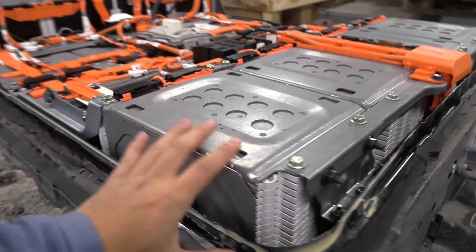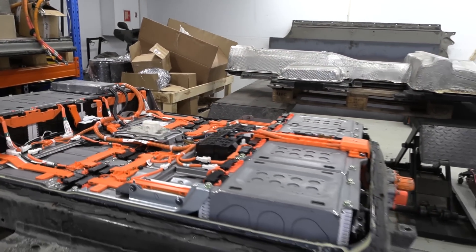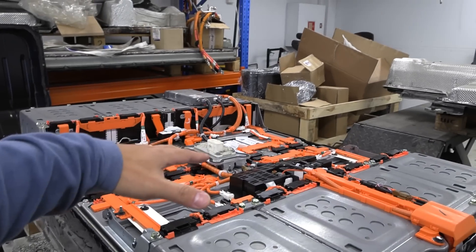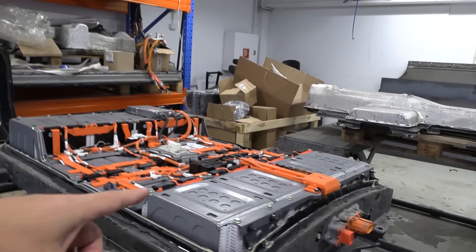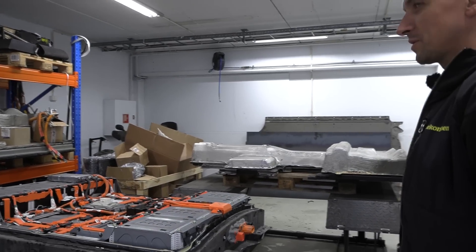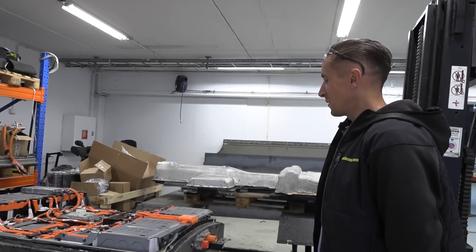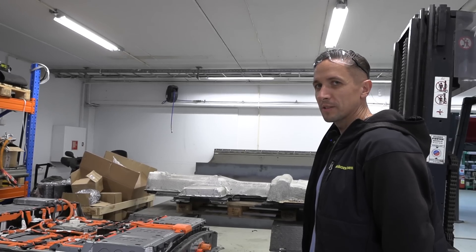Because it's packed so tight it takes a while for the whole battery to naturally cool off, versus the 24 kilowatt-hour battery which has way more space and less cells. Speaking of cells — the 24 Leaf, how many cells does it have? Was it 96? And what about this one? There's an unlike amount of modules, so we should calculate. The cells here are connected together differently.